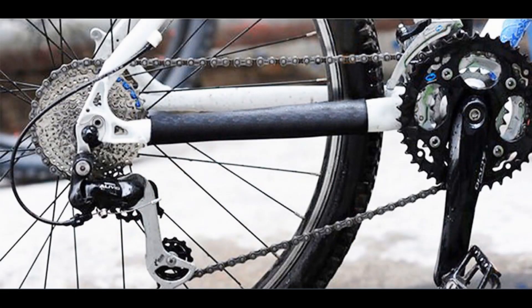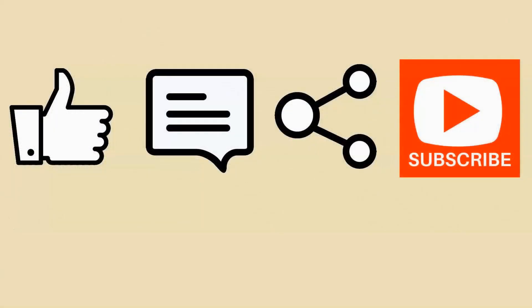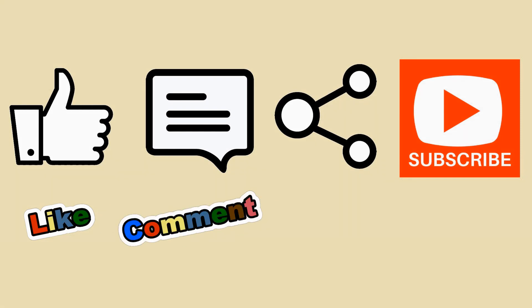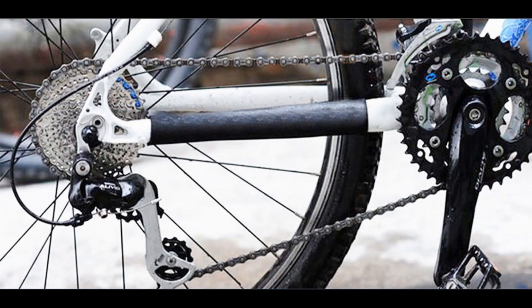This leads me to the next subject: drive systems — what connects the pedals to the rear wheel. The most commonly used system for transferring the rotating motion of the pedals to the wheel, on the vast majority of bicycles electric or not, is a simple chain. The advantages are that the chain system is inexpensive, lightweight, and very efficient, in that it doesn't cause a lot of energy-robbing friction. It is so efficient that less than 5% of the cyclist's or the motor's energy is lost through friction.